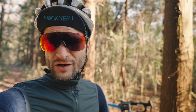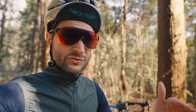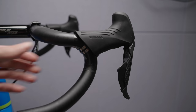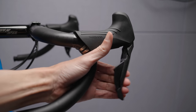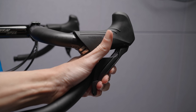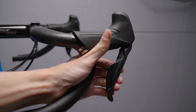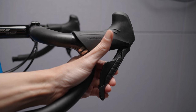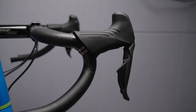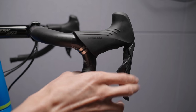Turns out the reason for that was the brake hose and it was in desperate need of a swap. So just to properly show the exact phenomenon: as I pull the brake lever it feels totally normal at first. The brake is biting normally, but as I keep squeezing the lever the pressure slowly starts to decrease and the lever goes all the way to the bar. As soon as I release the lever it goes back to normal, and I can still brake again the first few seconds before it loses pressure again. Now if this was an actual leak, the pressure would not go back up again — hence me calling this a ghost leak.